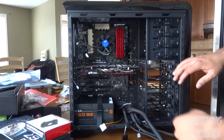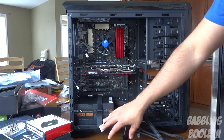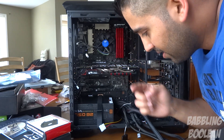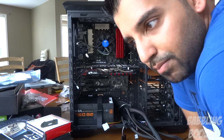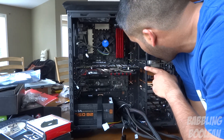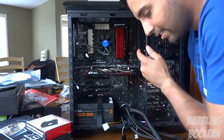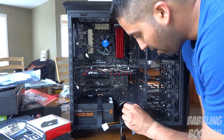There's no particular order you have to do this in — you can put the optical drives and storage drives in first, or work on power or the case. I want to work on the case. The issue is figuring out which slot on the motherboard works with which wire. Some are self-explanatory — for example, right here it says USB 3 underscore 12, so I know that's going to be USB 3.0, and that's going to be this particular wire right here.